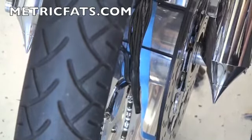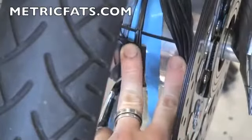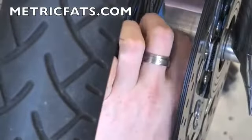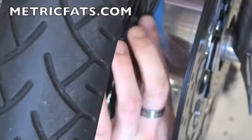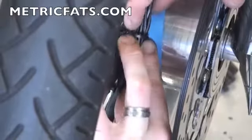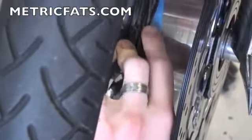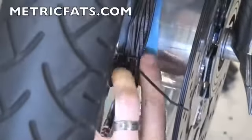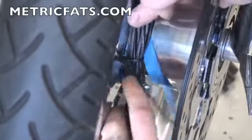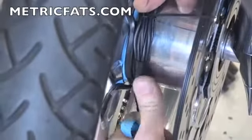Now, what you'll also notice is we've taken a wire tie and put it underneath the first wrap of LED wire as we came around, because all these LED wires end up wrapping around essentially once fully. So what we're going to do is we're going to tie the big bundle to that one individual wrap, and again, it's all on the double stick as well. So we're going to tie that in place, and then we're going to remove the remainder of the double stick covering, and stick it down best we can.